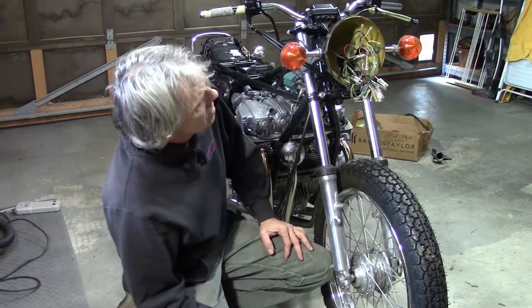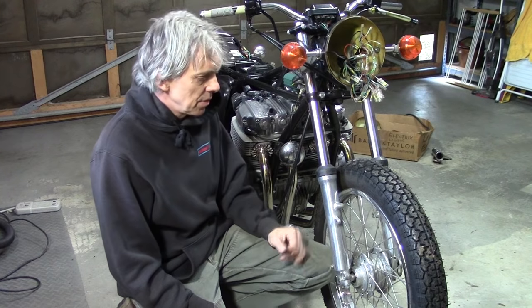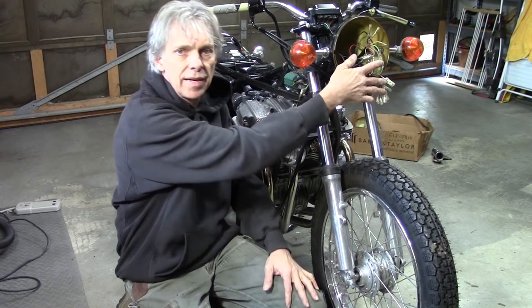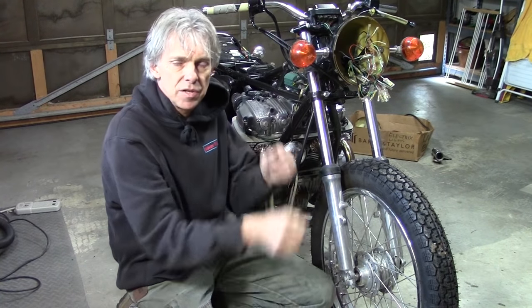Let's see what's next — get that straightened out. I think we can probably start putting more things in the bike: get the powertrain hooked up, get the front sprocket on, the chain on there and the chain guard. Then we're going to move on to brakes — front brakes — and the rear linkage has to be connected up, but that's all in future videos. This pretty much takes care of the electrical system. Don't let it intimidate you — just take your time. Use the wiring diagram. Use a continuity tester to test from the back to the front to find the wire you want, and make sure you get things connected right. The worst that will happen is you'll blow some fuses, so keep a few extra fuses on hand as you're doing this. Take your time — you will get there and you'll be able to figure it out.